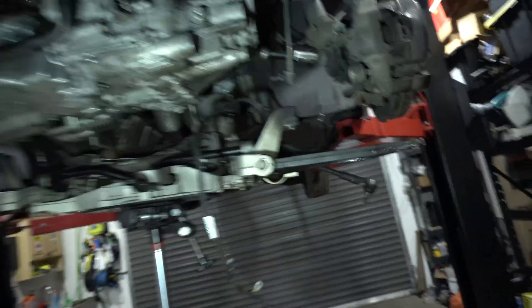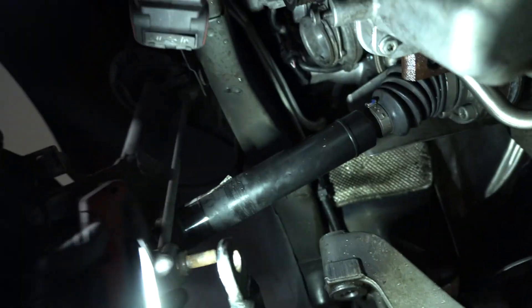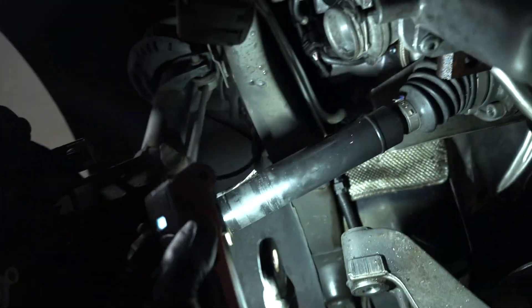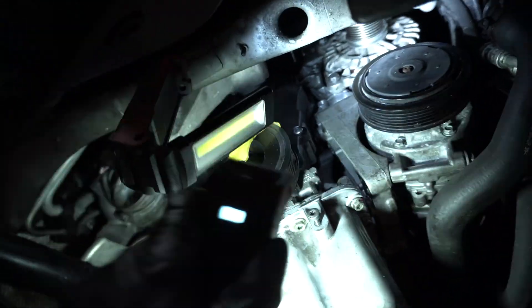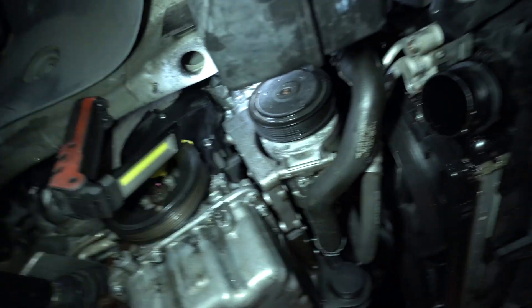Car's back on the lift — let's get this thing in there. We're up in the air. All the axles and the prop shaft have been torqued up. We got the subframe pressure washed and it's going in right now, securing it to the control arms. One thing to make sure: if your axles were swinging around or dangling, your sway bar link needs to be in front of the axle on either side. We're good there. Also got the AC compressor reinstalled. We'll have to do the final angle on the crank pulley and install the intercooler pipe and underpanel.